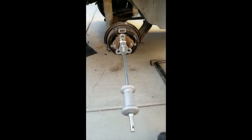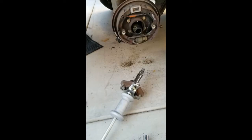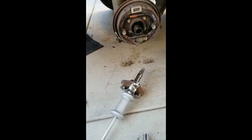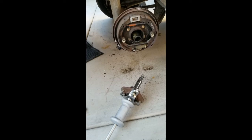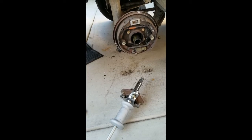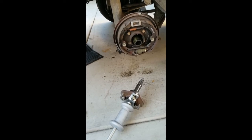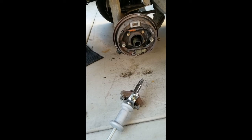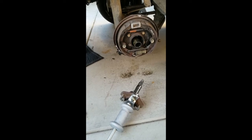I've got the new slide hammer hooked up and the broken flange off. Now I'm just going to give it a few more whacks. And there you have it — it did take quite a few more whacks on the slide hammer than I anticipated, but I finally got it out. The key is to make sure the slide hammer is securely tightened to that axle. Any wobbling will take away about 50% of your pounding force as you're pulling it off. After about 20 whacks I realized it was just a little loose. I tightened it back up and about two more pulls and it came right out.